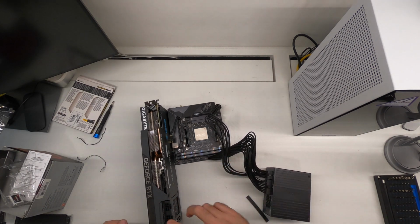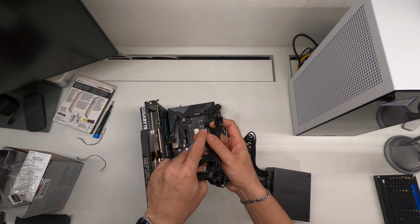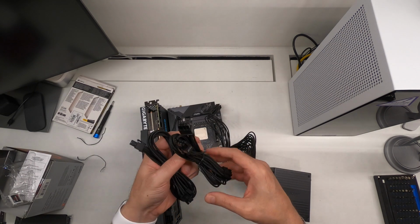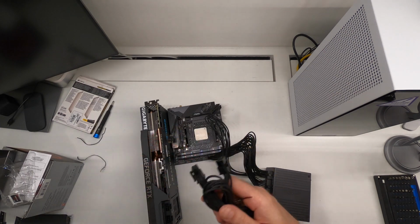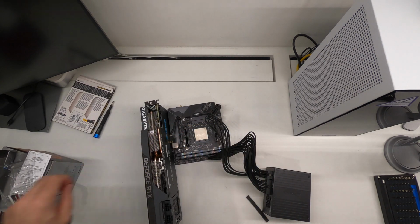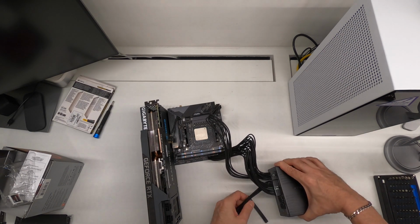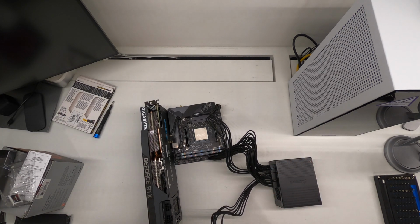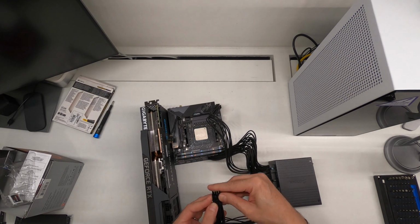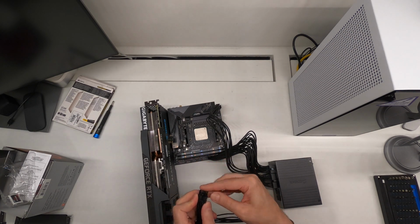Next, this GPU requires two points of power here, so let's get those cables. For the GPU, typically on the power supply cables you have PCIe printed on there, so make sure you get the right cables for this. Since we're benching, we can use one and daisy chain it. So let's go ahead and do that. Again, the PCI power down the bottom here, use the second slot. And they are 6 or 8 connectors. Just bring them all in line together. There's a little notch there that shows you how to align them.